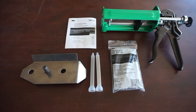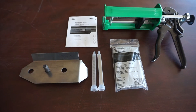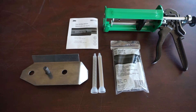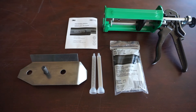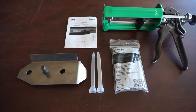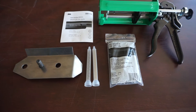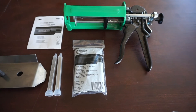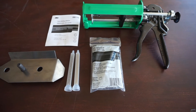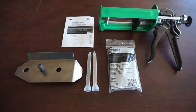Now that we've got the plates all ready and all the surface prep done with bare metal exposed, we're ready to put some epoxy on. One of the best tips I saw was to get your epoxy nice and warm — in wintertime, people put it in near-boiling water. It's the end of summer here, so I'm going to set it out in the sun for about 30 minutes to get it nice and warm; it tends to mix a lot better that way. Then I'll load it into the mixing handle here, which looks like a caulk gun but is specialized for the 3M product. I'll link that in the description below.